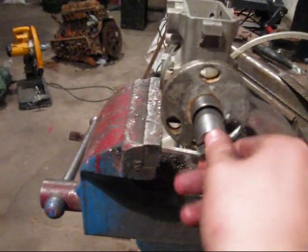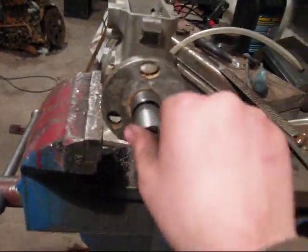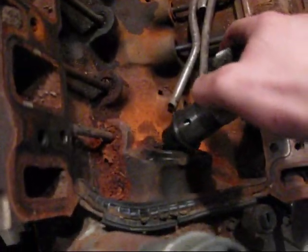There's a different type of mount between this pump and the 6.2 — the 6.2 is more of a circle and it bolts right to the gear. The injection pump connects right in here, into this gear. This gear basically fits in this hole right here and comes up through the bottom, though I can't put it in right now because I have the snap ring on it — but it slides up here.